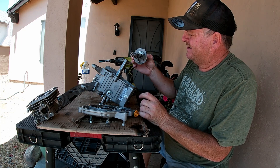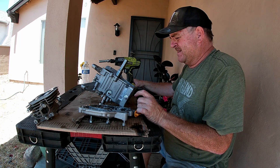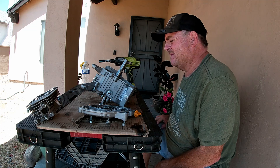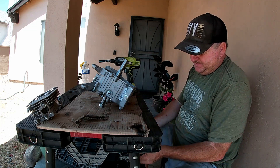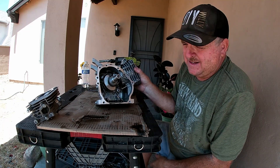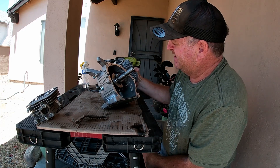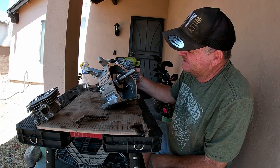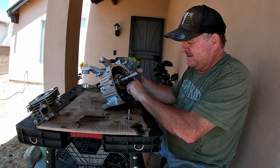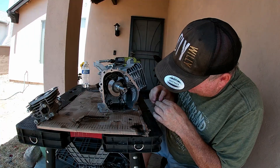Here is the original Hemi-Cam that we put on in our last build video. This time we're going to get to the rod and the governor. That governor's going bye-bye. Engine looks a lot cleaner than it did the last time I opened it up. Now with that new rod, I know I'm going to be doing some clearancing - we're going to get it in there and check it out, see how much clearance we've got.